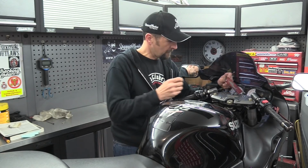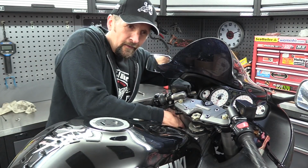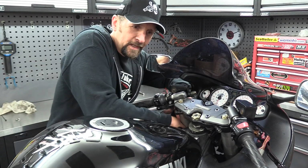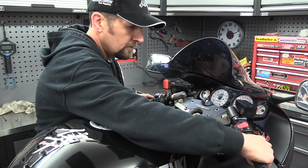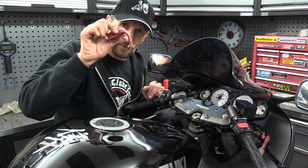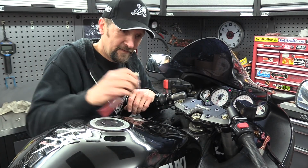So they sourced a second-hand switch to which they didn't have a key, and they've hidden it under this fairing panel. So you have to put the key, this is the fun part, in under this side cover panel, grope around in there. There's another ignition barrel been fitted under there. You pop the key in it, it's kind of a bit sloppy, and then you turn it, takes two hands, and you get ignition, and the bike starts. However, the key falls out because the ignition barrel that they fitted under there wasn't the correct one. They didn't get keys with it, so they've just chiseled it through so that a key, any key, fits in it and turns it.